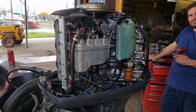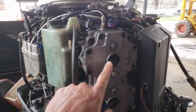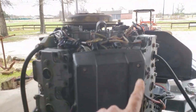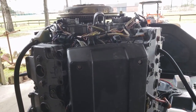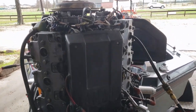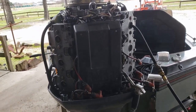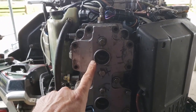When it came in this morning the engine definitely had problems. When we removed this spark plug — this is the number two cylinder — that's not necessarily the hot cylinder. The hot cylinder on these is always going to be the higher cylinder, because gravity dictates that. So if it was a water pump issue or an overheat issue, we'd expect to see the problem in the number one cylinder. Everything I'm saying is not gospel — this is just a quick overview of a problem we're trying to locate. So we're going to run a compression test.